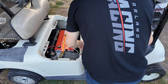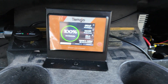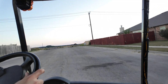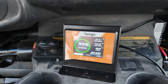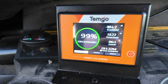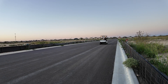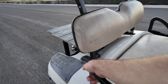Let's test it — and yeah, the cart moves! The battery is recharged to 100%, so we're going to do some full throttle pulls and hill climbs to make sure the BMS doesn't shut off and the golf cart hits its top speed. During full throttle acceleration we got about 180 amps and the battery did not cut off. The golf cart is running phenomenal — the battery is doing an amazing job and hasn't cut out or done anything weird.